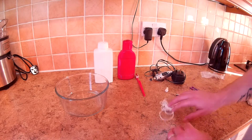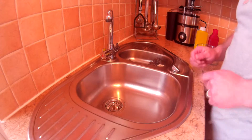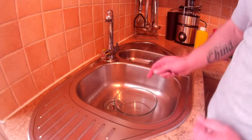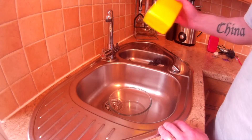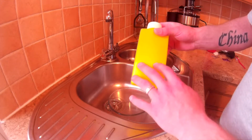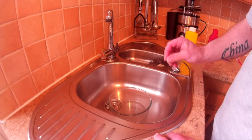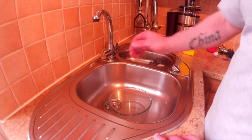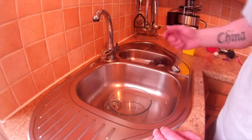To get started, we're going to switch over to the sink and start the process. The first thing you need is your bowl, and the reason we do it over the sink is because you fill the bowl up with warm water and put in your caustic soda. We do it by the sink because if you want to stop the anodizing process at any point, cold water will stop it - so if you get some on your hands, just run them under the cold water tap.